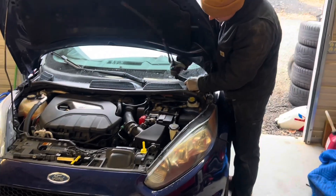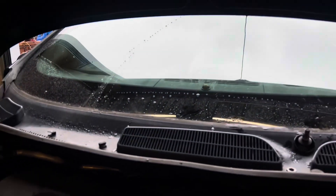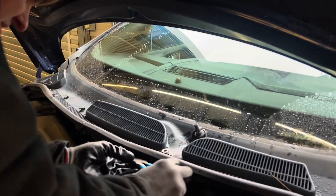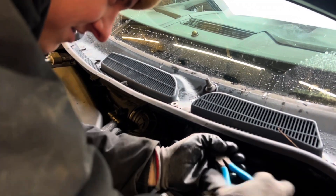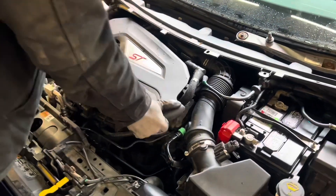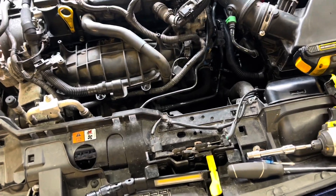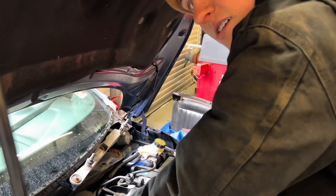What I do is bring the wiper plate up like this, just kind of wiggle it back and forth until it's free. Engine cover's off, and I put all my tools right here because it's plastic — it's not like the older cars where you had the metal and clear-coated engine bay. Make sure to check the cowl so you don't forget tools in there.